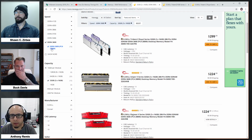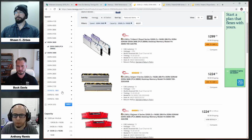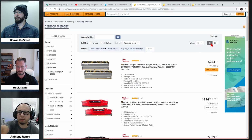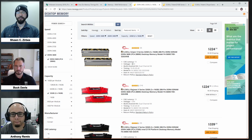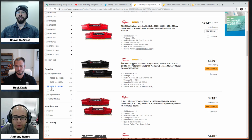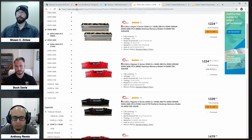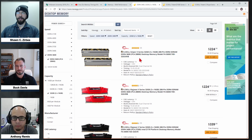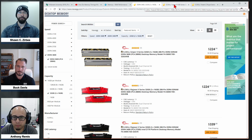We have two different sets of RAM, where one's a 3,600 megahertz RAM with 19, 20, 20, 40 timings. I think you have them open already, Shawn. I do. The ones at the top. I was going to pull this up on screen so you could see. Also, when you're shopping through, we had filtered out 3,600 and 3,400, and we were looking at specifically 32 gig kits. So for those of you who want to reproduce exactly what we're looking for, we're up on Newegg in RAM looking for these two things, 3,600, 3,400, and limiting to some common denominator here. We picked two memory kits, sort of at random, sort of handpicked a bit, and pulled them off to separate tabs up here at the top.